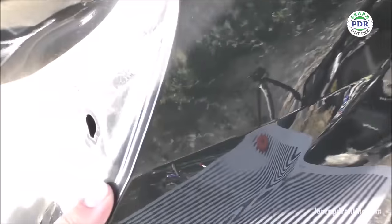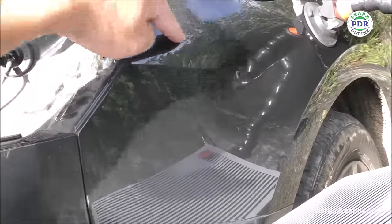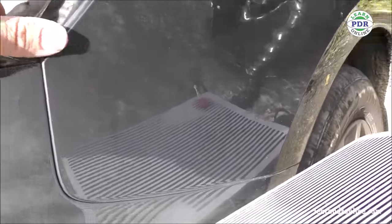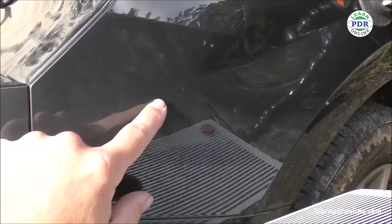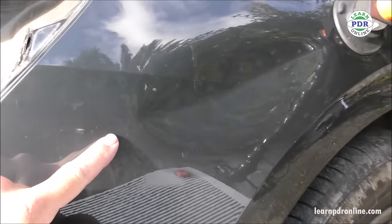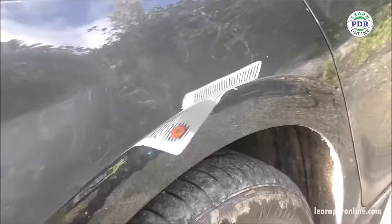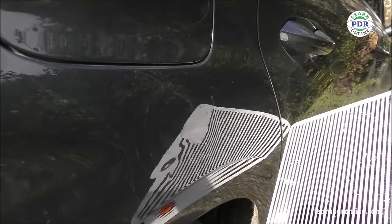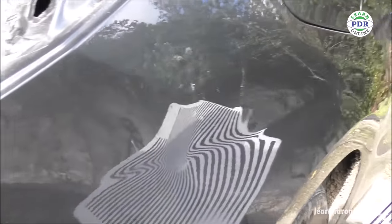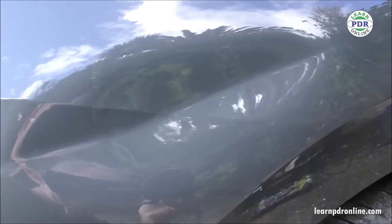So I'm checking for access points. I can get in here and get to this whole back section through this access point. What I'm currently thinking of doing is taking out this little piece of the crease as far as the main body of the dent, and probably do the same with the fine little creases on the other side. Take out that damage on each side, and that should leave me with just that dent. Then I'm going to glue pull that dent, trying to get that body line back out again.